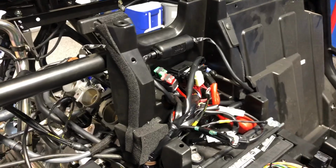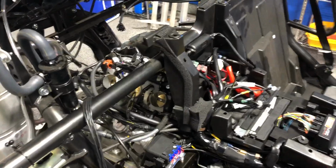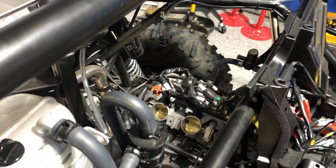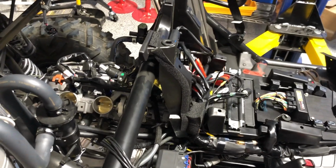which is actually the AEM version of it, but it works with his firmware. You can use this item. Saves you a little bit of money. So the AEM controller I mounted up here, and ran the harness around, and it comes out kind of where the exhaust is going to be, that's where the O2 sensor will live. Surprised to see this car doesn't have a factory oxygen sensor, but I guess it must be in open loop the whole time it's running. Well, some form of emissions, but I'm not sure how they're getting away with it. Maybe because of the smaller displacement.